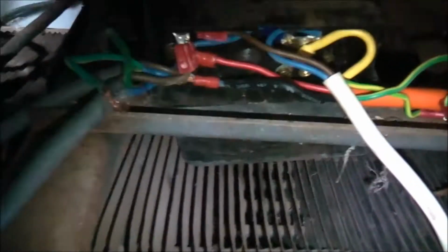I'm going to tie those earths together. Chassis earth there. I'm going to redo the earth on that switch for this light switch, earth there, because this old bare copper is the earth. I'm going to redo that. There's going to get earth on here. Got a lug on there, I bolt it to there, and between that, and that's going to be bonded to mains earth. This never originally was earth at all from the factory, although it was pretty well electrically isolated via a lot of plastic and this bit of wood, but it's going to get earthed, just to be on the safer side and make it compliant.